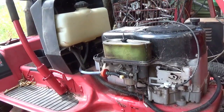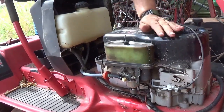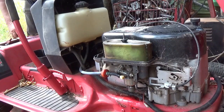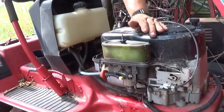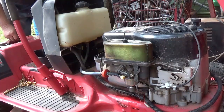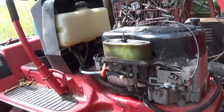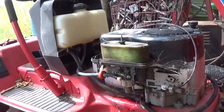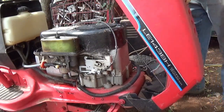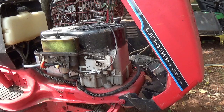The starter is not liking it too much. That could be a problem — it could be a starter problem. It doesn't look like it's turning. The starter is turning, but it sounds like it's not engaging. We'll get a hammer and tap on it — give her a couple of taps. It kind of sounds like that Bendix isn't kicking in, then it starts spinning.